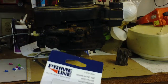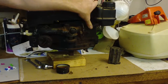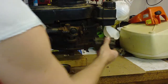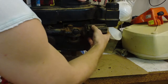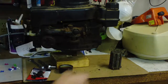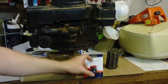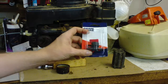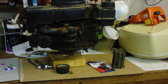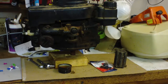Shut it off — fire it up, shut that valve off, and run it till it stops. This one's pretty tight, so that valve might have to be pointing downwards, or however you can get it on there, because the air filter might be in the way on this model. That'll definitely help prevent this annoying headache of these things not wanting to run — gumming up, deposits, and all.